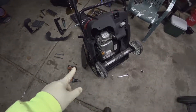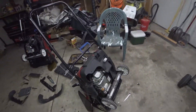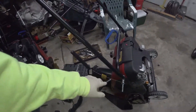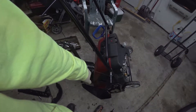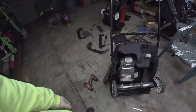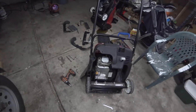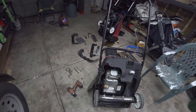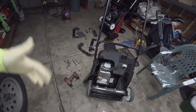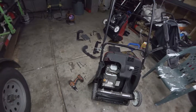I'm going to go ahead and take this off and get a new part, put it back together, and I'll have a perfectly good machine again. One thing that happens if anyone ever accidentally yanks on this cable, it'll tear through that plastic down there and that'll cause an issue. But aside from that, these machines are pretty rock solid. If you're having this issue where the paddles keep turning while the machine is started, then that's probably what it is.